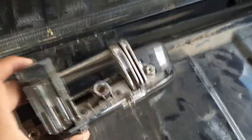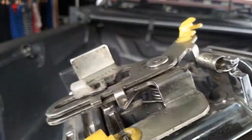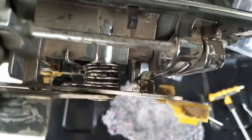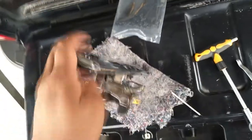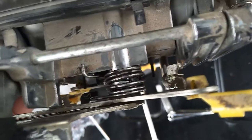So for you guys out there using Chevy — when you are unable to open the latch, this is what the issue is. This piece here is cracked. We'll try to glue it and see if that works. This is the final result: I've cable-tied the spring on the mount of the tailgate chrome so it doesn't open. We also used some epoxy resin to make it stick and not crack again.